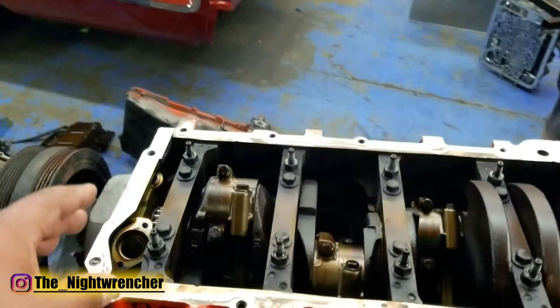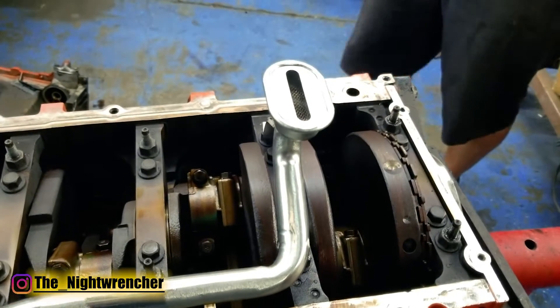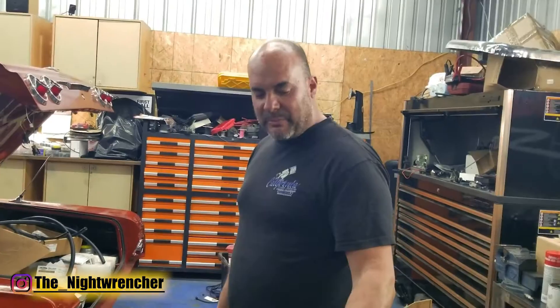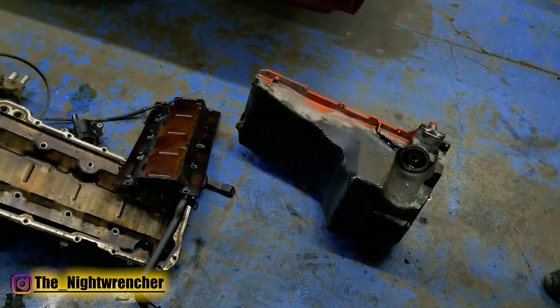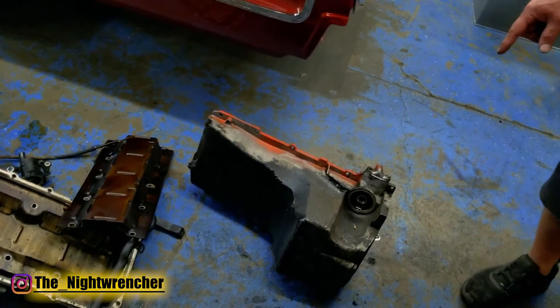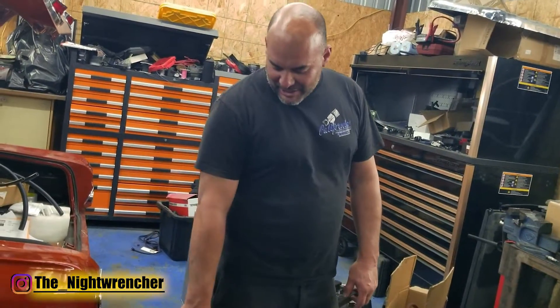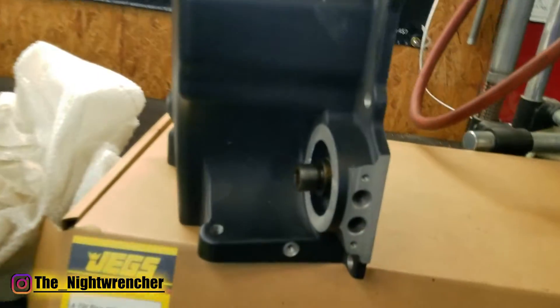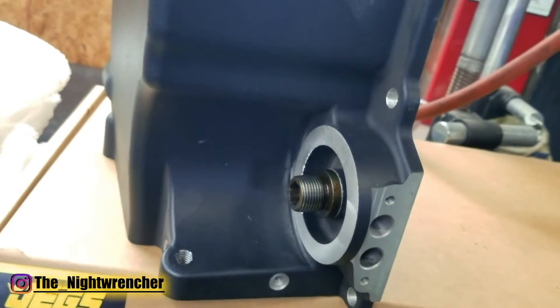The pickup for this is actually this one over here, and I'm joined here with Anthony from California Auto Works. Anthony, why do we actually have to change the pickup if we're just changing the oil pan? We have to change the pickup to line up with the depth of the oil pan. Also, we cannot use a truck pan on a Chevelle because it'll hang below the subframe and turn into a speed bump. Also, we had to change the fitting on the F-body pan because we didn't get a truck adapter, so we took the one off of the truck pan and put it on here so we can use a taller truck filter.